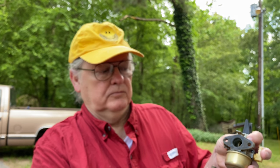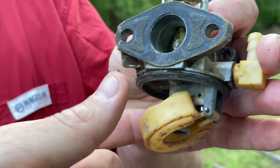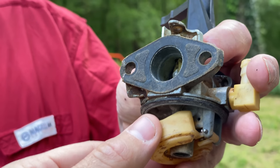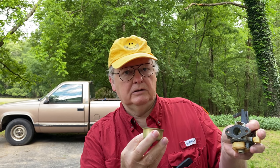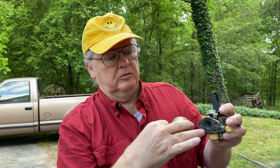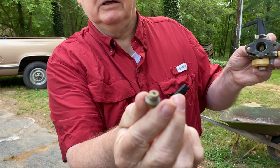So the bowl is now full. When the bowl is full, the float comes up and closes the needle - like a toilet. You want the mixture between oxygen and gasoline to be liquid in here - nothing but liquid. The air is going to come through this way, through the choke, through the air filter, and it's going to be sucked out through the cylinder. The little squirt of gasoline comes up through the center - that's the main jet.